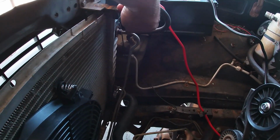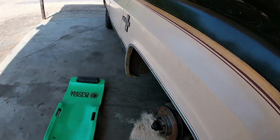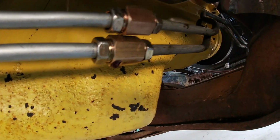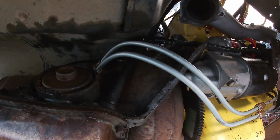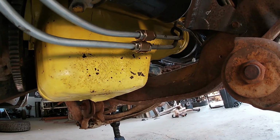So when we left off, we were talking about tranny cooler lines. I got those all done. That's the factory lines off of the parts truck 97. Then, as I said I was gonna do, I came down here, I flared them, put unions in them, and then I made my own lines out of brake line. That's the same size, 3/8 brake line. It goes up to the transmission. Put new fittings in the transmission to accept the 3/8 lines. Bent our lines, flared them, ran them into the unions. And now we have 3/8 tranny cooler lines instead of 1/4 inch. So a little bit more fluid. Maybe it'll last a little longer. Probably not, doesn't matter. But anyways, they're done.